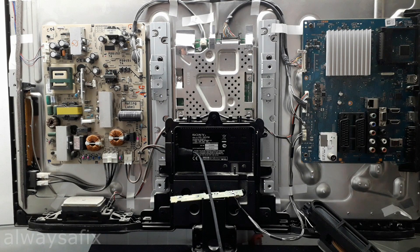The TV's been on for a couple of hours now. When I first did the test it did switch off and go back to several blinking lights. I've ended up disconnecting cable number 12 as well — so cable number 11 and cable number 12. If anybody needs a pin schematic for this HLR infrared board, hit me up on the email. So we've disconnected pin 11 and pin 12, disabling the ambient light sensor.